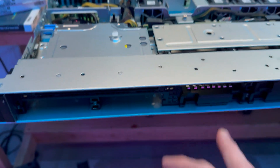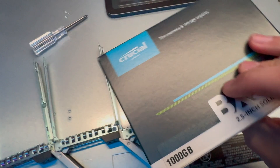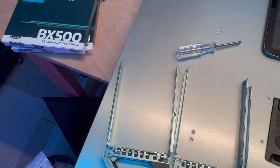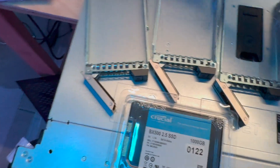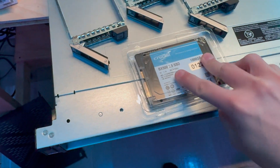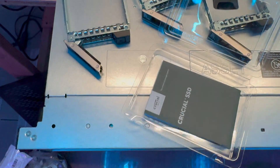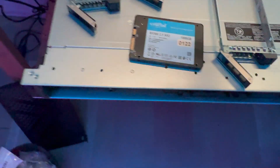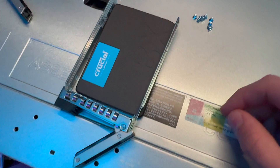We're actually going to do one, two, and three. So we have these ready to go here. Now we are on the part where we install the SSDs for the server. I have purchased three one-terabyte SSDs — this should be fine for now. I just buy parts that I can use now and in the future. This will last me a while, hopefully, and three terabytes is a pretty good amount of storage. Really, all that's going to be on this server is just active virtual machines, so anything offline or long-term storage will still be stored on my 88 terabyte hard drive array. It's more of just fast enough storage for virtual machines. We're going to install these trays and slide the SSDs in.